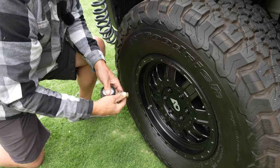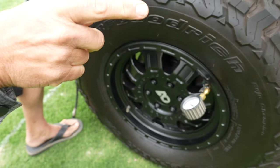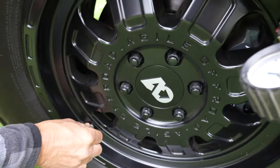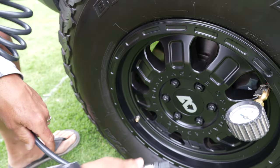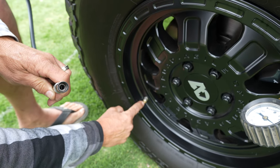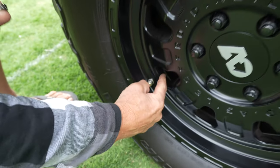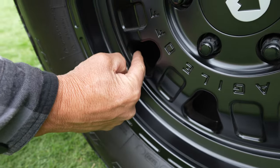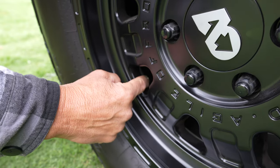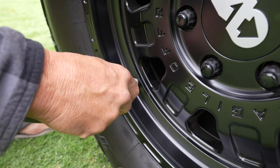Here's the reason why there are two valve stems in this tire. I'm going to put the gauge back on and turn on the Sprinter. It's important when you're airing up your tires to run your engine. Here's the second valve stem — it's an open chuck, really large. It works kind of like a one-way ball inside: whichever pressure is higher on either side of this ball, it's going to fully open. Right now there's 24 pounds in there, so this pressure is greater than the pressure on the outside. We're going to change that by threading this on.